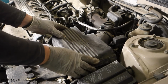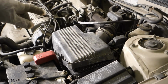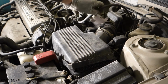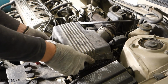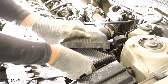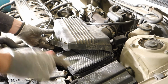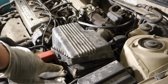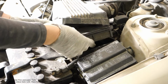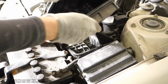fasteners. We can take the cover, and then, by the way, there is the gas pedal cable in this position, and we need to take that out maybe also. Then we start to lift it up a little bit, and when it is in that position, we can carefully take the old filter. We check that the old fasteners don't act like stoppers. We move these away, and then carefully in this direction, we pull out the old filter.